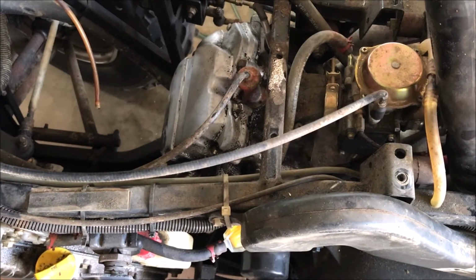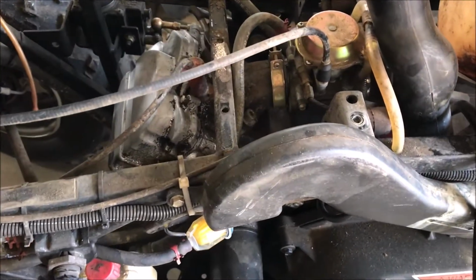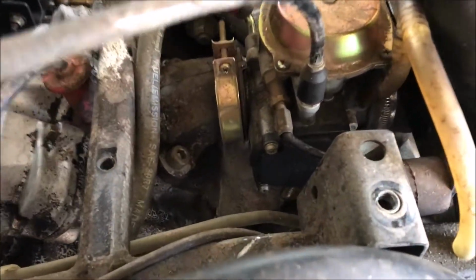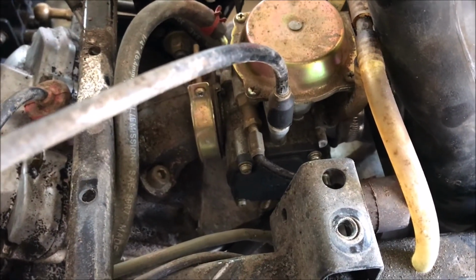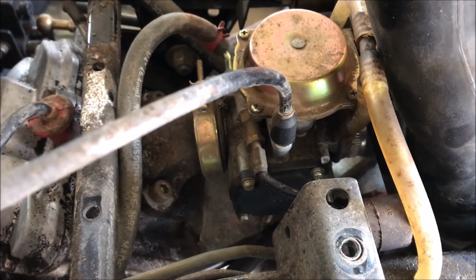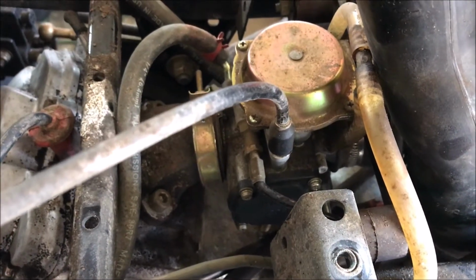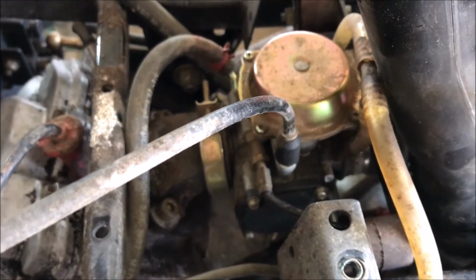This old guy DIY video has to do with replacing the spark plug in a 1999 Polaris Sportsman 500. The machine hadn't run in about 3 years, so initially it wasn't getting fuel. I had to pull the carburetor out, and I found that the needle that attaches to the float was all gummed up, so it wasn't letting any fuel into the bowl, and also the main jet was plugged solid, so I cleaned those two things out and it ran again.